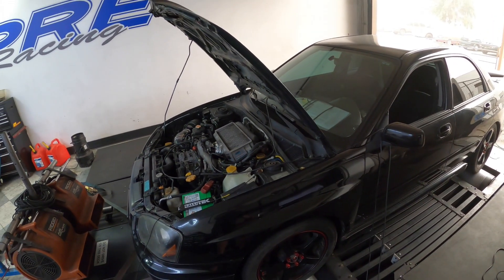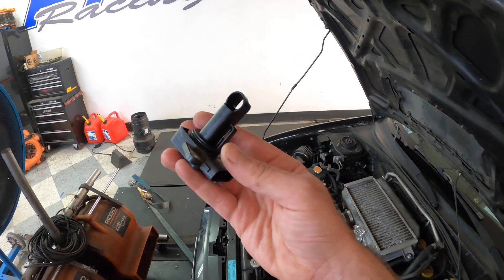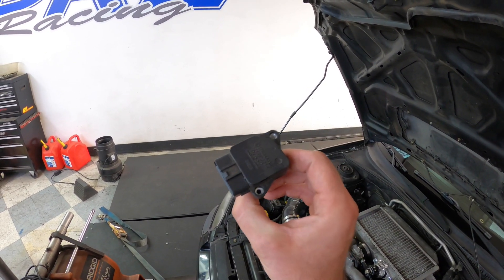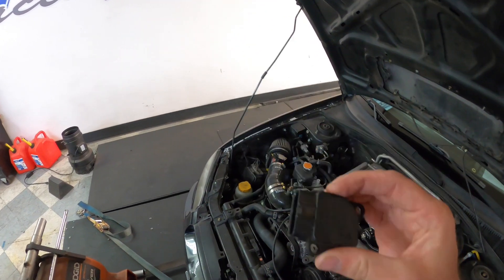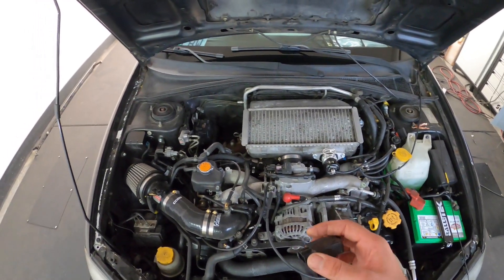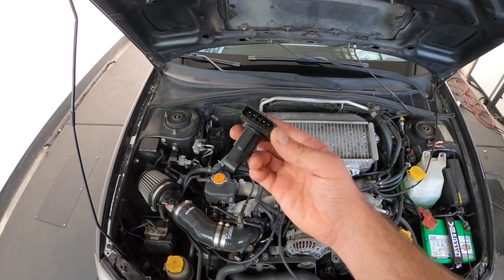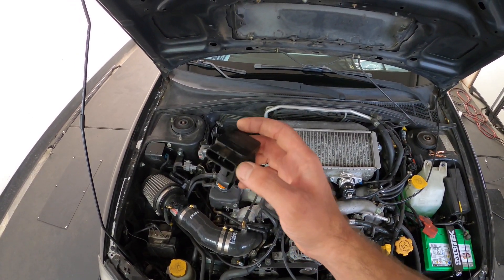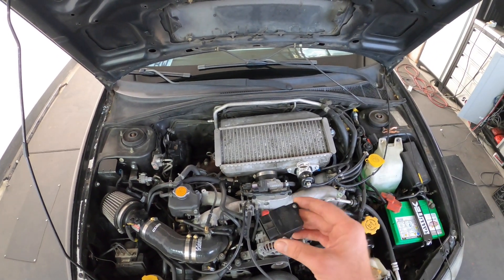I'm talking about this guy right here — this is the mass airflow meter. I've talked about this in other videos and getting rid of it and switching to speed density, and there's a good reason for that. If this sensor stops working, every single calculation in your engine is wrong. It reads all the airflow as it comes into your motor, and as it measures that airflow it tells the car how much fuel to inject. Not only that, it also tells it how much ignition timing to give the engine. So if this starts reading low — instead of reading four volts it reads three and a half — you have significantly less fuel and significantly more ignition timing because it's gonna read less load. Now your engine's running lean and it has more ignition timing — talk about worst-case scenario.